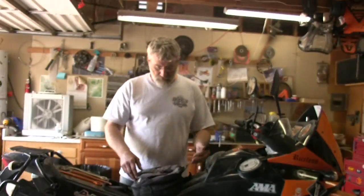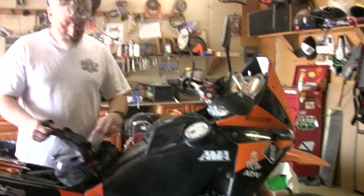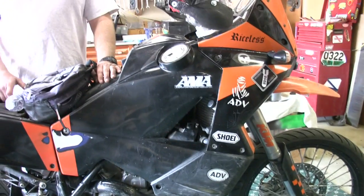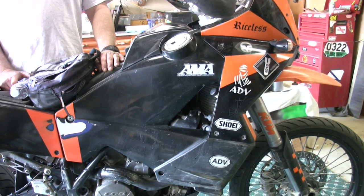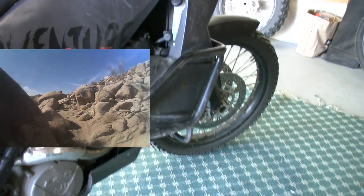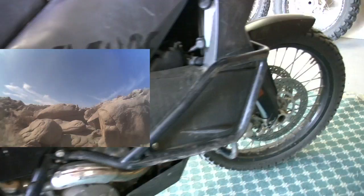I take a lot of grief for not running crash bars from other riders, but that's part of the reason I don't like to run them - it's a deterrent to maintenance. I look at the bike and say do I want to work on this, and then I have to take the crash bars off. Easier access for working on the bike. I also like not running them because crash bars make the bike wider - if you clip a rock, the bar could make you crash where otherwise you might just go by it. Crash bars suck basically - I crash a lot.